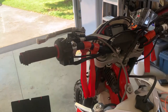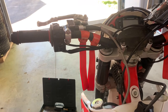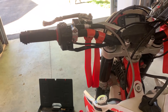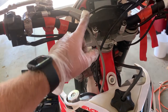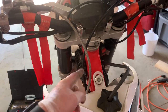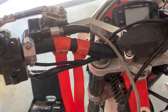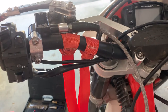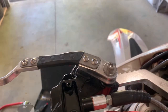Second snag — the clutch line on Betas is too short. To try it out without spending a hundred dollars on a plus-two-inch cable, I've rerouted it. It typically went from here, up under the triple clamp, then back around the front into the master cylinder. I disconnected the little bracket that was attached and I'm running it just up and over the handlebars, which gives me enough slack for a couple of rides to see if I like it. But that's a huge pain, and I've been bleeding this thing for over an hour now.